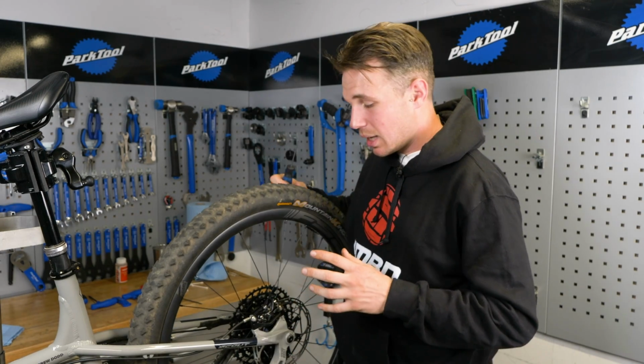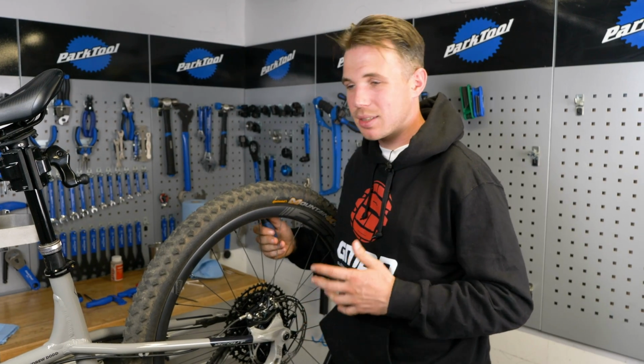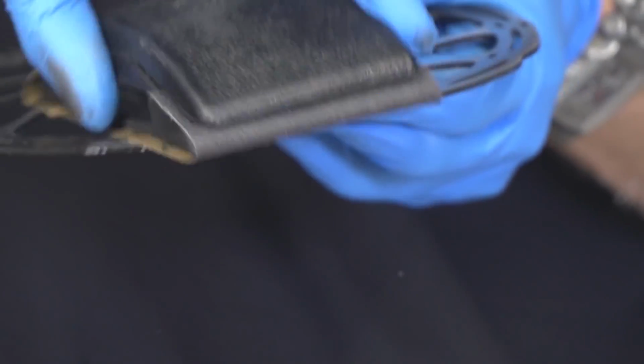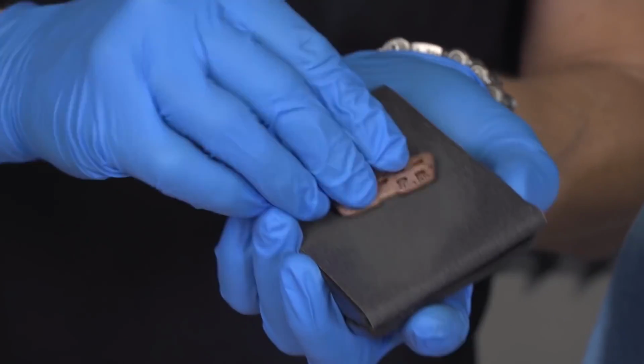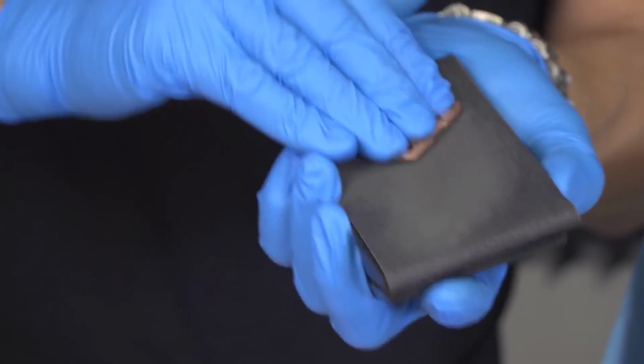You can also, if you have really cooked your brakes, the tried and tested tip, don't be afraid just to get some sandpaper there and scrub up the rotor, not in the direction of travel. Same again with your pads. If your pads are ever shiny or anything like that, just take the edge off, and that's going to really increase bite and braking performance.